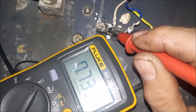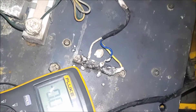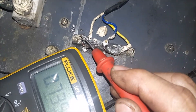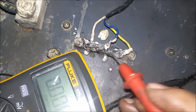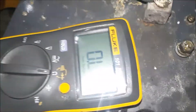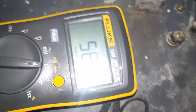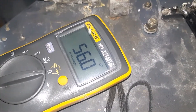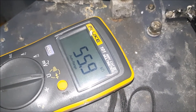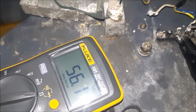That white wire leads straight to the lip lock relay coil, and it should have been 24 volts. So I'm going to desolder one end of that resistor and check it. After desoldering, I place my black lead on that end — the reading is way out of spec: 56 kilohms, and it was supposed to be a 180-ohm resistor.